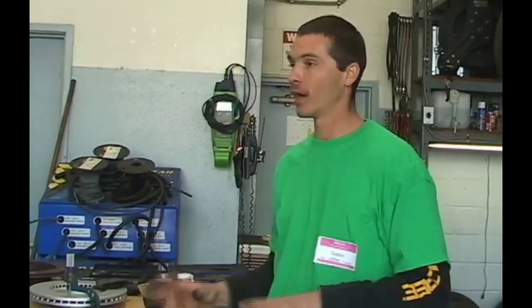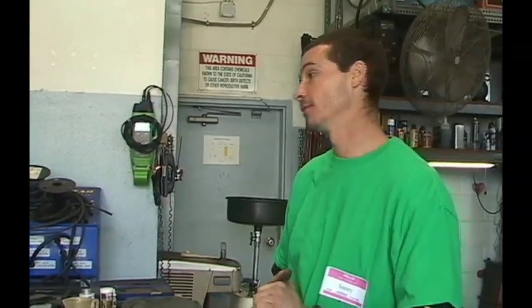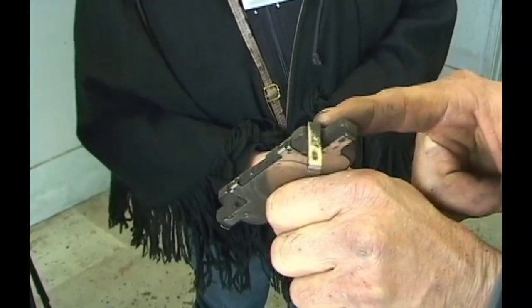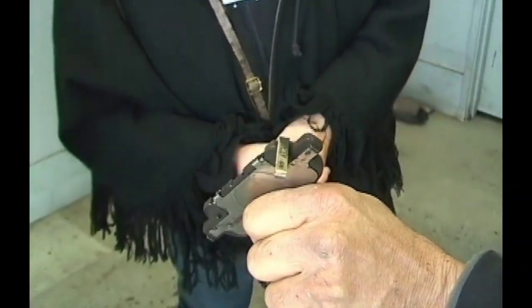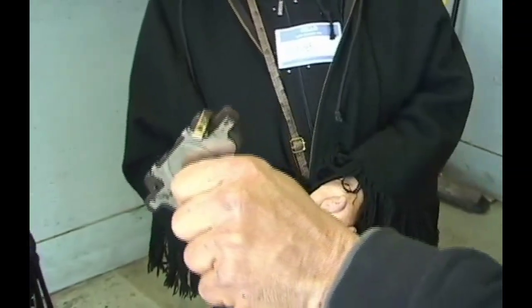With some people, 30,000 miles could be very quick; with others it could be months or years. If you're doing like a thousand miles a year, I would say more like once a year — kind of the same thing as oil changes. Brake fluid is very, very important. This brake pad here — you can see the material — this is a wear indicator. This wear indicator will start to drag on the rotor when you're applying the brake and will typically make a high-pitched squeak or squealing, sometimes a skipping chatter sound.